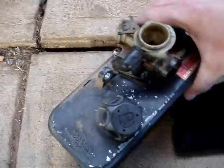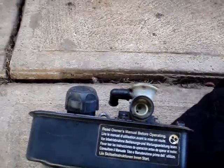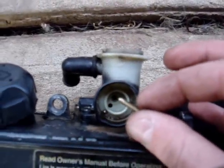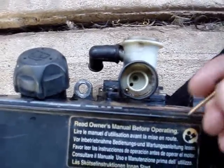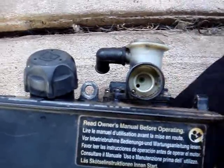I think I found the problem. When I took the carburetor off and took the primer bulb off, there's a tiny little ball bearing in here behind a seal that can actually be removed, and it had been stuck up with stale fuel. Even though the tank had been stored empty, there's still always a little bit of fuel floating around, and that turned into honey.